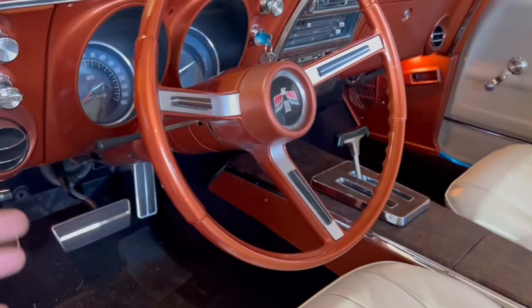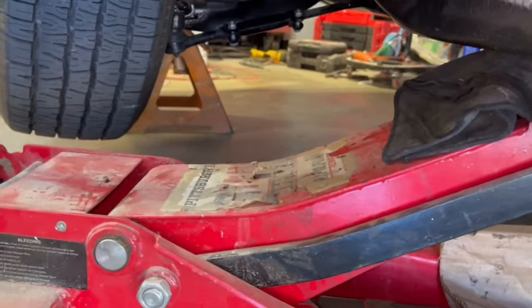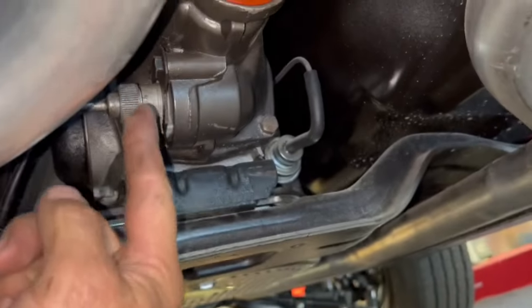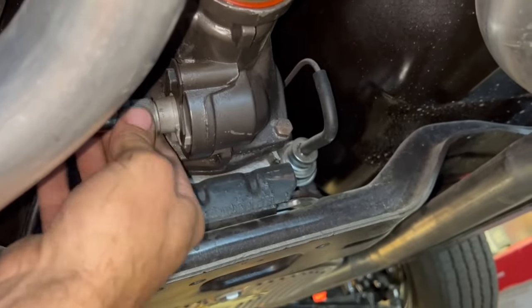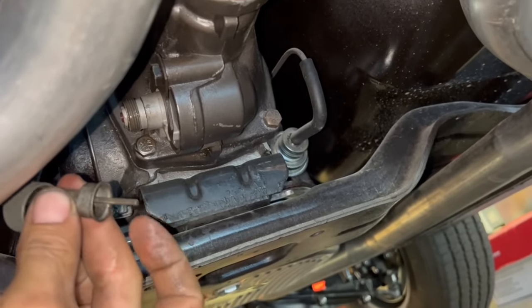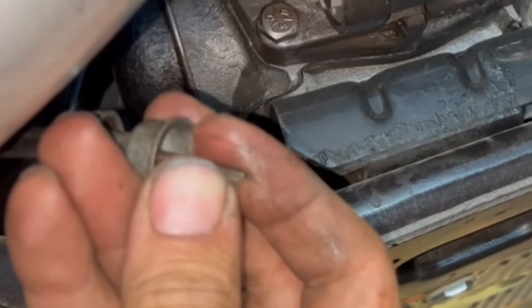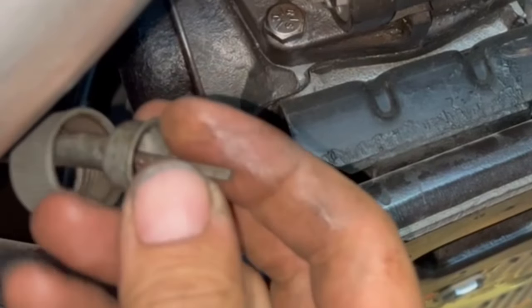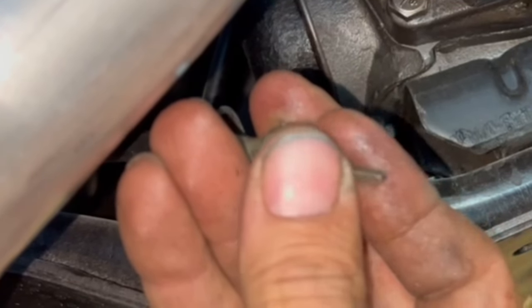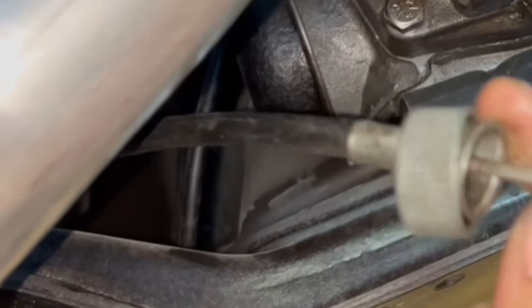See how much drag there is, or does the needle move or bounce — get an idea which way it goes. We've got the car all lifted up with a jack stand on the front. We're going to climb underneath here — here's the speedo cable, right here at the tail shaft for the output end of the transmission. That should be as simple as unscrewing it right here and pulling it out. This is our speedometer cable; it goes up to our speedometer head. It actually feels pretty tight. It almost feels like it wants to spring back a little bit — you can see it actually springs back. So I think I need to pull the cable out of the car and inspect it.